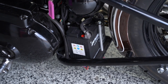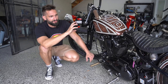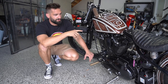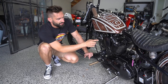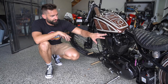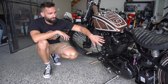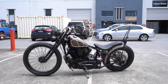We've also replaced the battery with a standard lead acid and had to modify that little battery box on the back. Another little tidbit — because of the sprung seat, we haven't really got any way to hide our electronics. So this bike's running off one of our black box modules, which gives you headlight high and low operation from our push buttons. We've had Donnie fabricate up this little cover, reminiscent of a later model horn cover. It mounts off the side via an engine bracket, and this cover plate sits over a backing plate where we've mounted our black box and a terminal strip. This thing houses all of your lighting and electrical connections other than the charging and the ignition circuit.